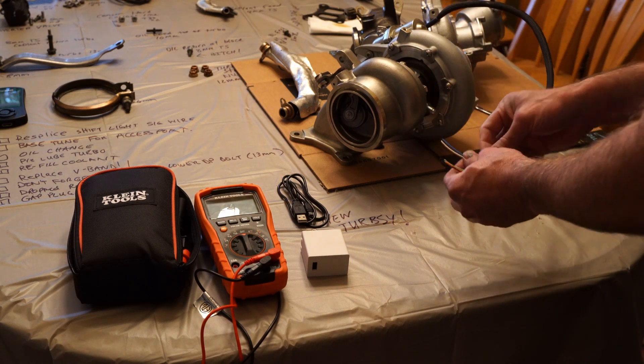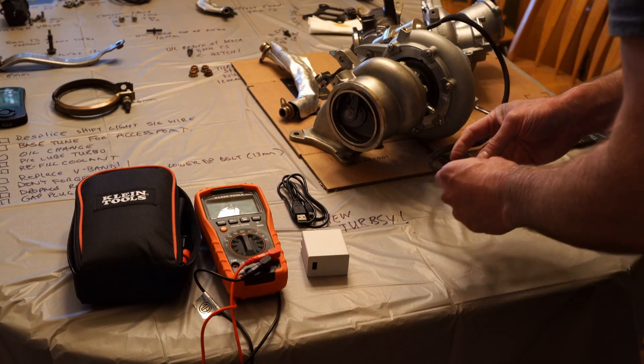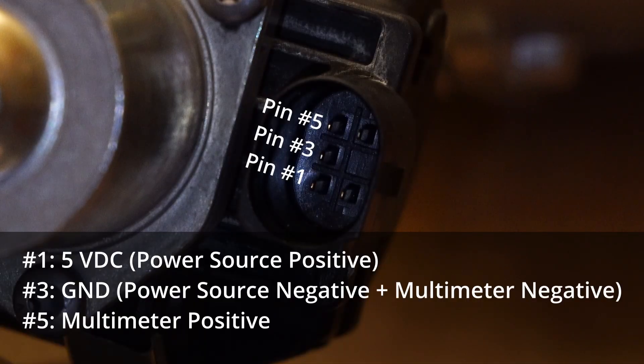The colors on this harness don't really matter, and most of you probably won't have this harness, so you'll have to figure out how to connect to these pins — maybe little tiny alligator clips or make your own connections. Pin number one is going to be for our 5-volt DC power source, which is why we're using a 5-volt USB charging adapter — an iPhone charger, an Android charger, whatever. Pin number three is going to be ground. You're going to connect both the power source ground and the multimeter negative side to pin three. Pin number five is going to be the positive lead for your multimeter. The other two pins won't be used — those are for motor control.